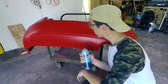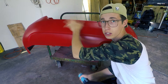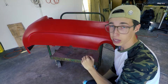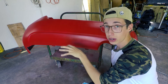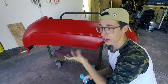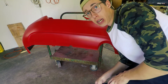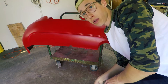I'm actually pretty hyped on this right now. It doesn't look perfect but it does look way better than it did with all those dings and scratches and chips. The money is going to be in the clear coat on this one — I hope it comes out well. The surface is a little bit bumpy and rough, it's not as good as I wanted it to be, but when you're working with strictly rattle cans this is pretty much the best you can do. I have to wait about 10 more minutes for this to dry, wipe it down with a paper towel, then do the first coat of clear pretty light, and go as heavy as I can on the second one.